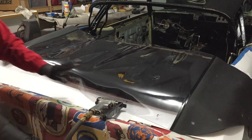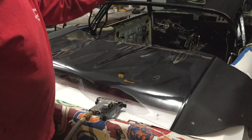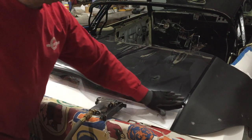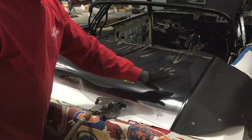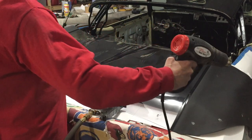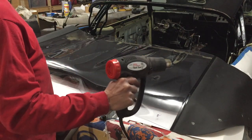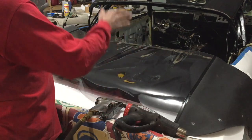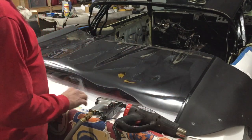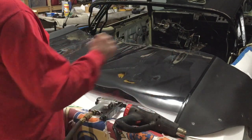As I work my way around this back window, the side panels aren't as critical to get really smooth at this point. Definitely want to get the final outside top smooth, but this area around the window is probably one you notice the most — if I go to a car show, I usually always end up seeing wrinkles in here. Typically what that is: you have to have this window pulled super tight side to side, both at the top and at the bottom. If you don't, when the sun shines on it and heats it up, it will give you a wave across different areas depending on how it was pulled tight. I like to do my tops in the summer — you can pull it out in the sun, get it nice and hot, and really move it.